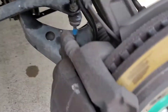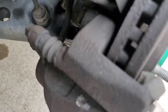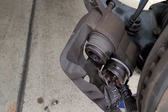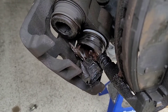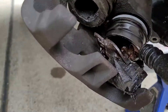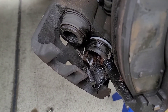With the wheel off, the next step is to pull the brakes off — remove the hardware, take the caliper off. I'm pretty sure it's the caliper itself that blew. After getting the caliper off, the brake pad had worn down so bad there's nothing left. Part of the caliper actually fell out on the ground where it got eaten up and broke into pieces. So we're going to be changing the caliper along with the brake pads and rotors.